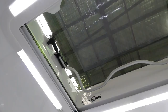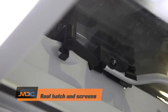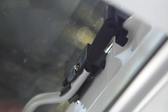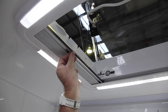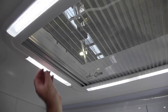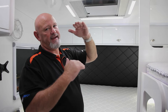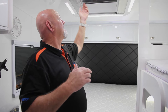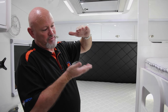In the 16, above your main sleeping area you have a hatch in your roof. It's got the same tabs as the windows — you still have a button to push on both sides, a handle that swings down, and then you can open it up and push it up. There's only one setting: either opened or closed. You have privacy and fly screen, and can do 50-50 if you like. But be warned: when it's closed up and you're not using it with your blind across, it builds up a lot of heat — a lot of hot air between the two surfaces. On a 40-degree day it can go up to 70 or 75 degrees. So make sure that's open so it filtrates through and you don't get any warping.